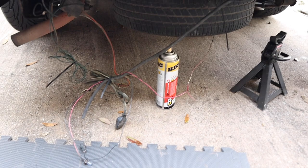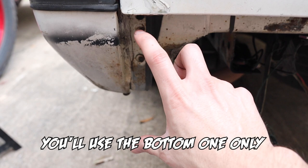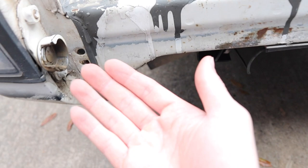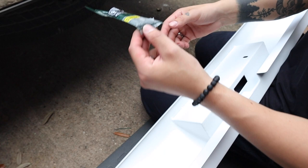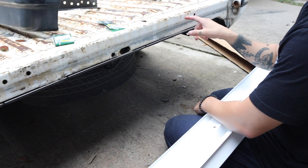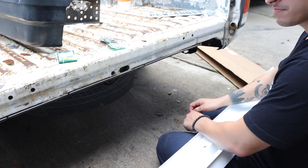We're going to clean it up, get rid of it, and then put the new roll pan in. It should be fairly easy — there are bolt holes here and it attaches with two bolts on each side. We had to go to the store for hardware, and the closest match we found was #12-24 bolts about an inch long. The bottom bolts are mainly for lining it up so we know where to drill on the top, and the top is what does most of the heavyweight carrying.